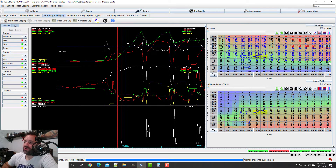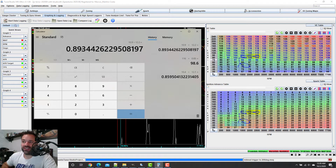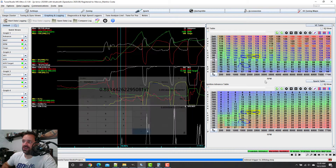So we know that this is wrong. Before I change it, let me look into the pulls. I'm going to show you that we are between 15 and 17 percent off. In the graph, I have first gear here, second here, and third here. Going to the side, you can see it's a little richer — I was supposed to have 12.2 and I have 11.8. Now we have 10.9. So: 10.9 divided by 12.2 is around 89 percent of the value — so this is 11 percent off.